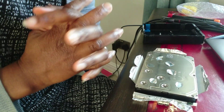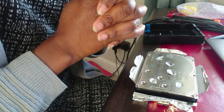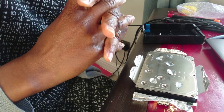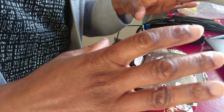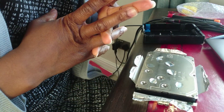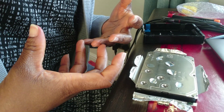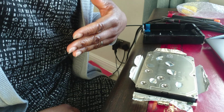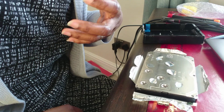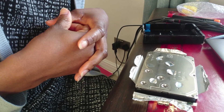Once you've undone that, it is important to say that if you really wanted to definitely get your data off, and you don't have a clean room that's free of dust, or a box you can work within, then just don't open it — the more you open it, the more likely you are to contaminate your device. If you have the money, send it off. If you're willing to forego what's on there and want to use it as a learning experience, then go ahead and try it.